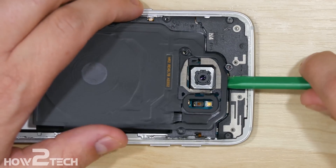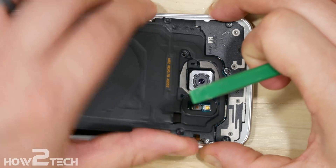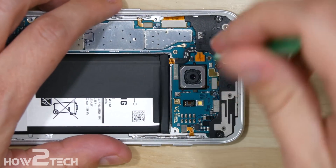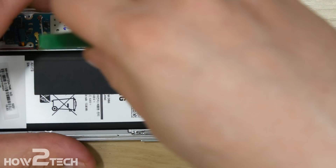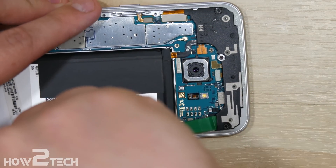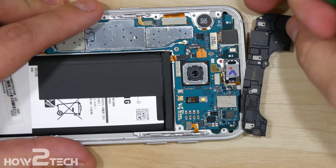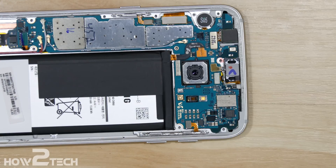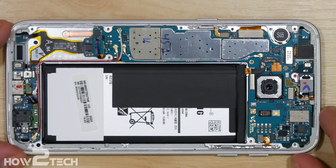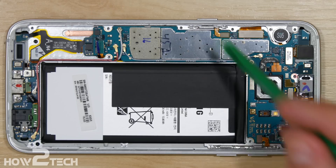There's a little adhesive stuck to the proximity sensor up here. Go ahead and work on removing the top portion — this pops right off, with a little adhesive here as well. Now with the backing removed, we can see all the internal portions of the phone. The next step is to go ahead and remove the logic board. To do that, we have to disconnect all of the connectors to the phone itself.